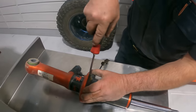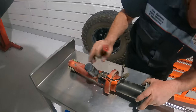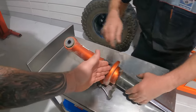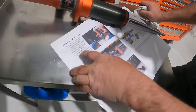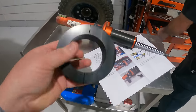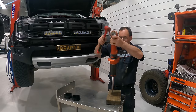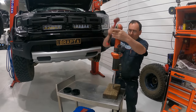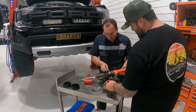We've essentially just got the instructions, so we're both doing this for the first time — it's a new product from CTP and we're going to experience it all together. We're going to remove the wiring from the back of the collar here, and then apparently hit it down, but we're reading the instructions. There are circlips — it's saying hit it down first and then remove them. So essentially the collar is going to sit in about this position, just there. It seems like it's coming down pretty easy.